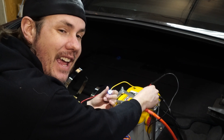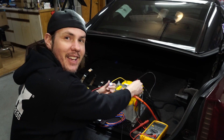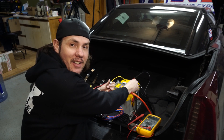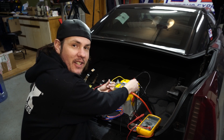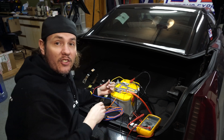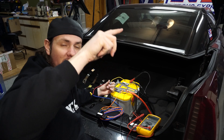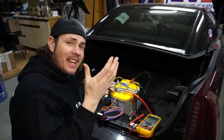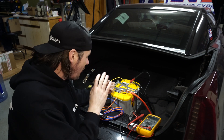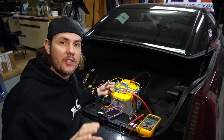Our trigger wire goes back to our ECU, and our ECU in this case sends a PWM — pulse width modulation — negative signal out to trigger our relay. On most of the base model aftermarket ECUs it's going to be PWM negative; some of the higher end ones can do PWM positive. You need to use the signal that your relay is expecting. This one is expecting a negative, so if we go ahead and touch this to our negative post — basically giving it a negative signal — you can see the light flashing on and off. That is the relay closing. Basically what we will be doing through the ECM is pulsing this a lot.